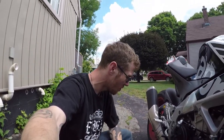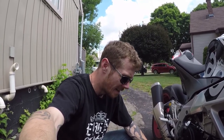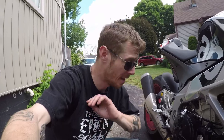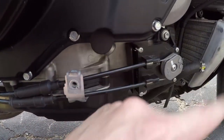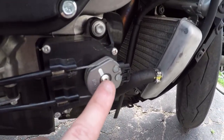Just remember: don't unplug your servo — just remove the cables. We're going to do that right now; it takes about two seconds and it's really easy. These are the cable adjustment points — you loosen these up so you have enough slack to actually take the cable off. This is where it attaches on the servo.